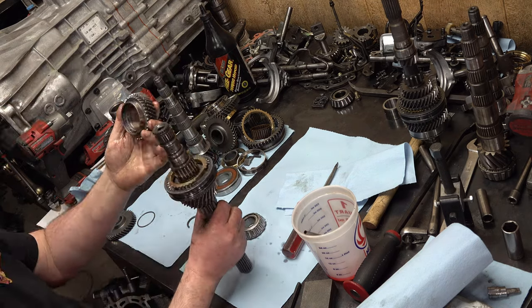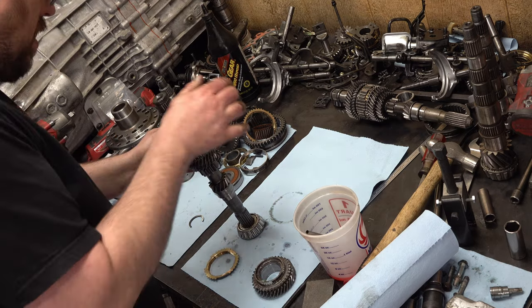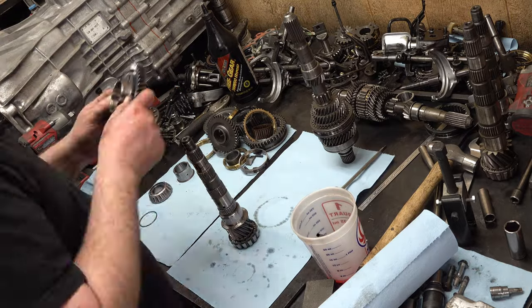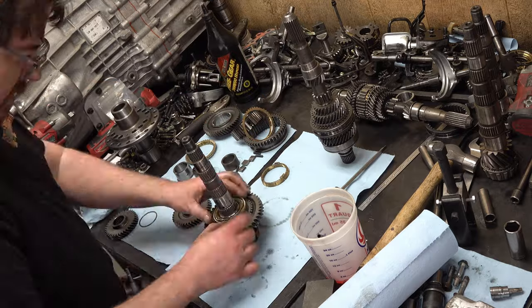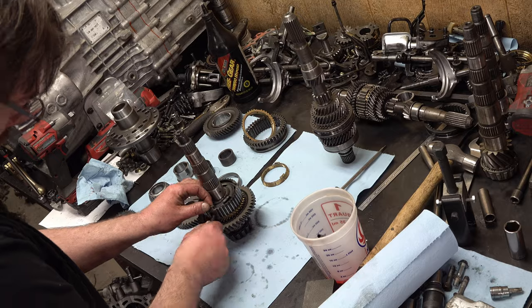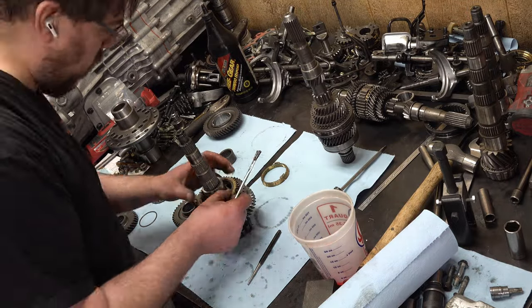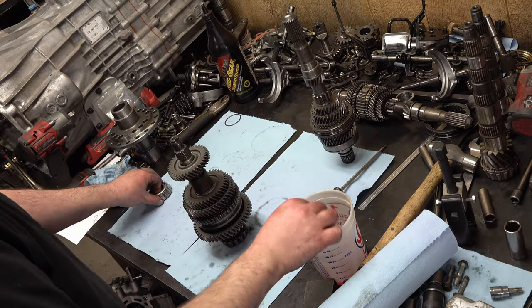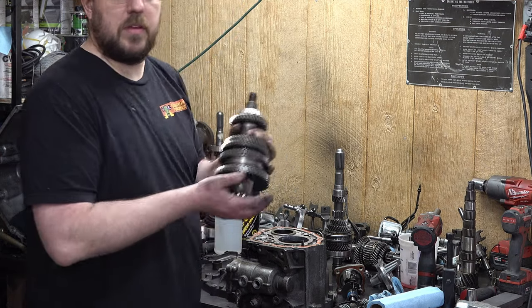Here you can see I'm struggling — it's not obvious in the video what I'm struggling with, but it doesn't want to shift into what I think is fourth. I never figured out why, but I disassembled and put it back together and it shifted perfectly, so something must have been just slightly out of place. Either way, you just want to check these things and move everything through the motions when you're putting it back together — that'll ensure you've got a working transmission. Of course I'm putting this together by memory, I've worked on these E-series so much that I don't need the manual, but the factory service manual is really really helpful — it walks you through all the steps and things you need to check.